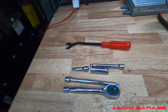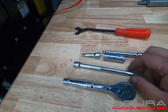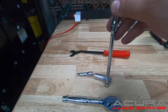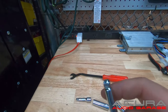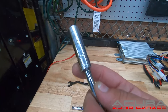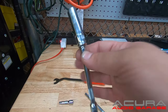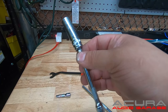To install the plug-and-play amplifier, you're going to need either a ratchet or a 10mm wrench. I recommend a ratchet with an extension and another extension with a swivel at the top. The swivel will allow you to get at a certain angle, which is really helpful so you don't have to remove a lot of panels.